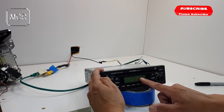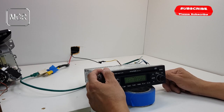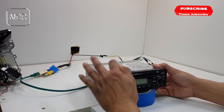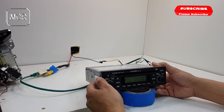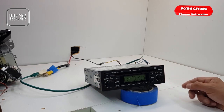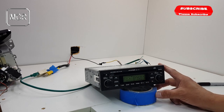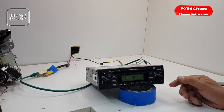When you've got that, press number five and it says 'welcome' and goes to the radio station. From then on the unit is unlocked and will work like normal. If you ever change the battery for whatever reason, you still have your code number, so just write it down and keep it for your own record. That's all there is to it for most Hyundai stereo single DIN units. Thank you for watching — just a short video on getting the code number from the serial number of the unit.